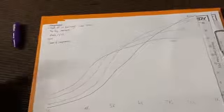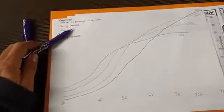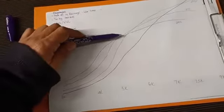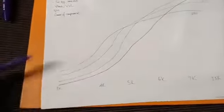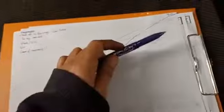So what happens is, imagine a Honda VTEC or a Nissan Neo VVL, the SR20VE. The best way to illustrate that engine would be, they've got really small camshafts, like this line here, and then at a certain point it switches to a bigger camshaft, let's say our red one there, and then you've got a really wide spread of power. There's no compromise and loss of power down low, so you've got power down low and power up high.